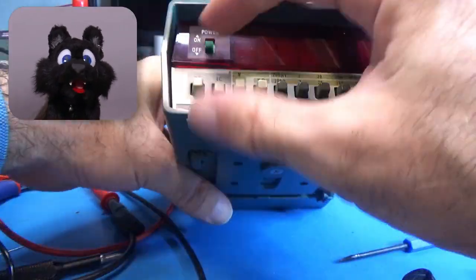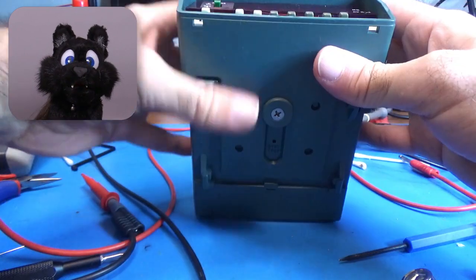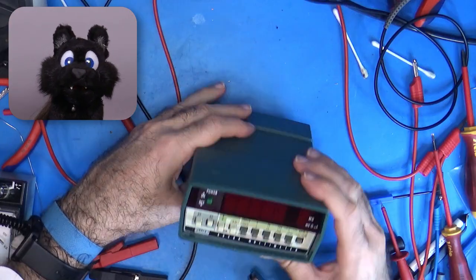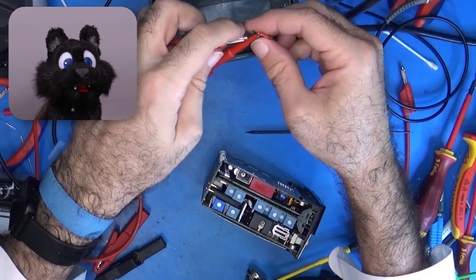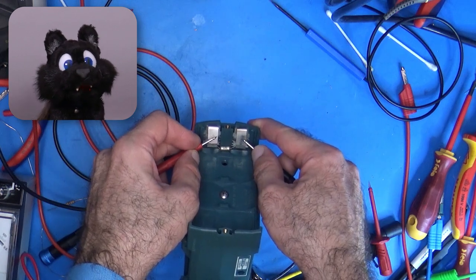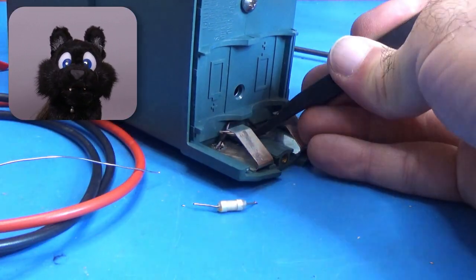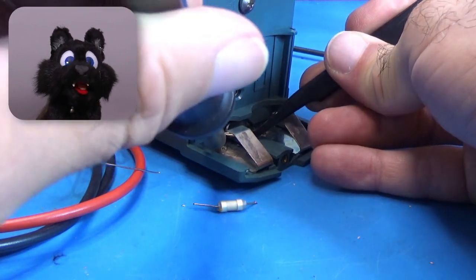And was greeted by a not-working one. What now? Open again — the battery wire came loose! Trying again... still dead. The wire is connected, but why is there no battery voltage? Now the thermal fuse in the battery compartment is blown for some odd reason. Maybe the loose wire shorted out the battery pack? Anyhow, I don't have a replacement, so I'll just bridge the contacts until I have one.